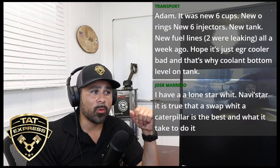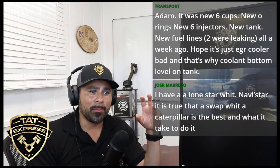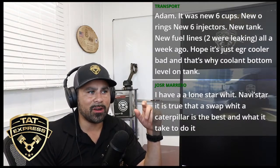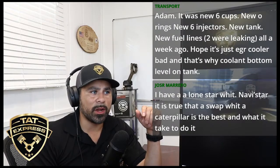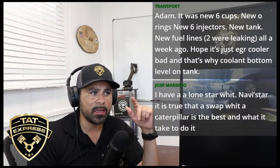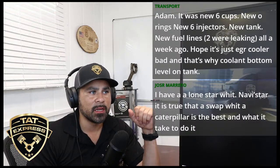And yeah, it will corrode brakes, brake components, brake hoses, brake lines, air lines. Those are all susceptible to corrosion. So getting your truck washed on a regular basis is going to help prevent that corrosion from getting worse, and add it to your pre-trip and your post-trip inspections. So keep that in mind.